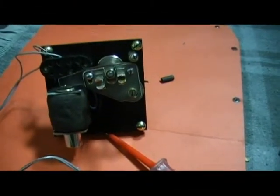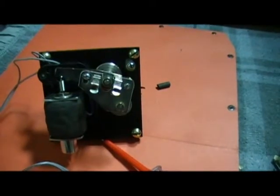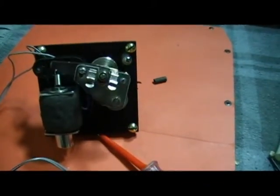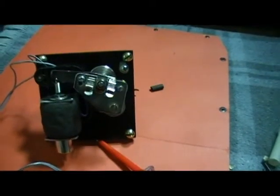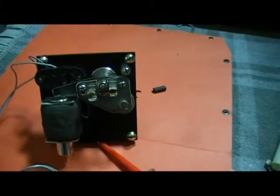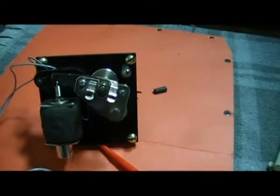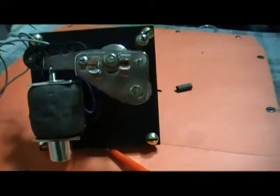Let's put a little bit of juice to this and see what she does. AC coils — don't you love them? Well, obviously that IBM Technician's Mod is no longer necessary. I'm just switching on and off manually using a 24-volt AC power supply and a toggle switch, which is the click you can hear in the background. And she's not jumping out of her skin — just a little bit noisy. So I might just see if I can find a way of tightening up the coil a bit and stop some of that hum. If not, we'll just have to live with it. That's nice — it's a nice one.